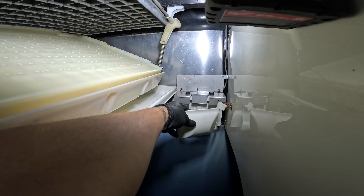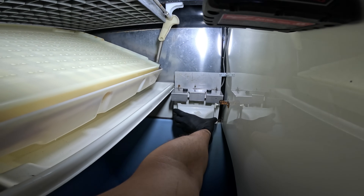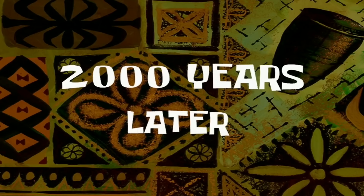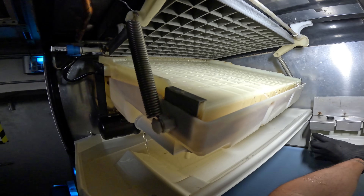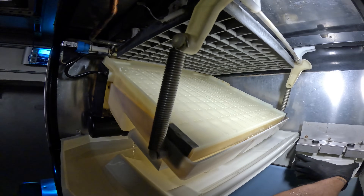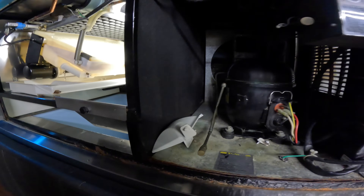Let's see if I just hold this next to that piece there, see if it registers. Just going to hold it there, see if anything happens. The condenser fan just started. Systems coming up — probably going into defrost harvest cycle. Yeah, it's in harvest cycle right now. That's the problem here.